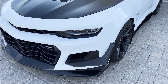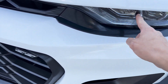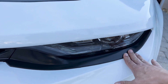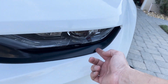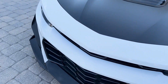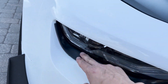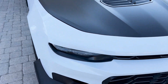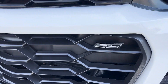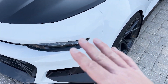The other difference for this bumper is it also brings this piece, which I think is for 19 and up because in other years the light is more squared and doesn't have this follow-through. We put a little double-sided tape on it, and behind there's a screw that holds it on, so once you screw it on it holds pretty good. One side clipped good and the other was a little loose, so we moved it around and ended up putting a little tape just in case until the car gets driven and things settle. I also moved the SS emblem from the other car to have it all black - it looks amazing.